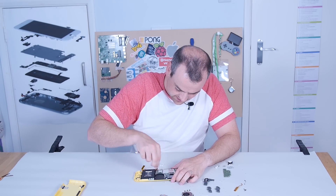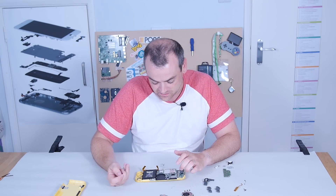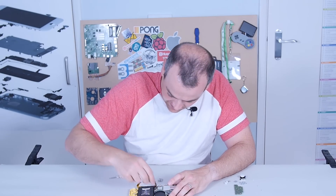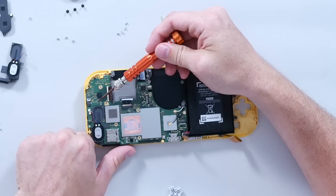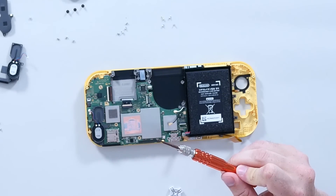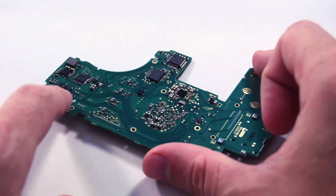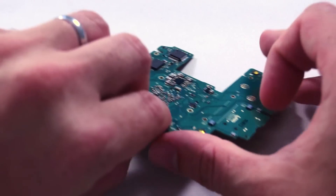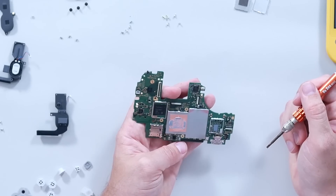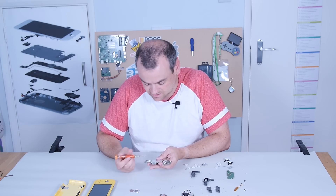It's still got a nice Wi-Fi antenna — good to see a device that doesn't have an embedded PCB-style one. I definitely prefer a proper antenna over on-board. Interesting that on the PCB here it's labelled Side B, and similarly on this one, Side B and Side A. Across the board you've still got really wide differential pairs from the USB-C. A lot's changed, but not a lot has changed. It's nice that there are test points on the PCB — for your own debugging, or if you ever wanted to do mods to it, having exposed test pads really does make the difference.